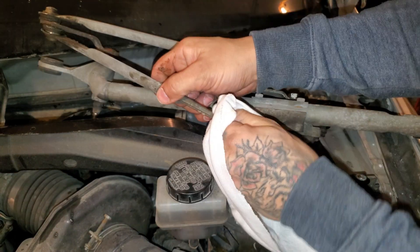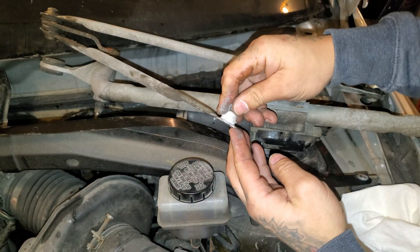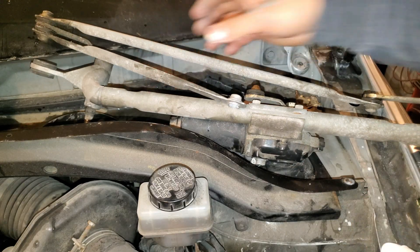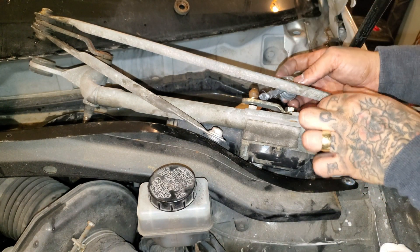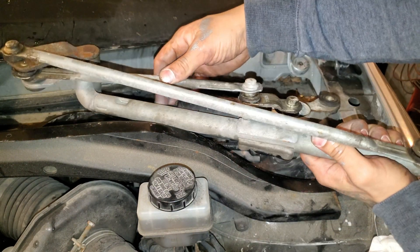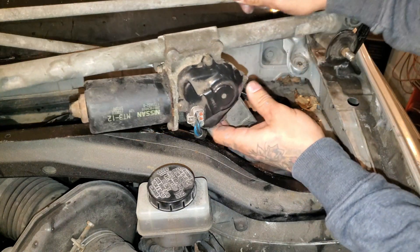Now we have a box full of replacements. First, clean the surface. This next part is optional — if you have anti-seize, use it; if you don't, don't worry about it. Apply a little anti-seize, set it in there, and just like that it's assembled. Now that the new bushing is in, take this rubber off for a minute, apply anti-seize to the actual ball joint — again, optional — then slip the rubber back on. Take our arm, place it on, take our hammer, and just lightly tap it into place.